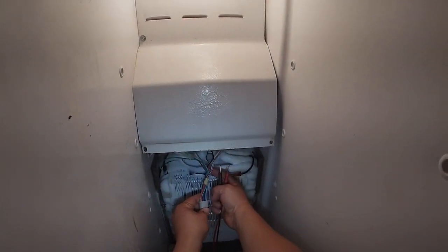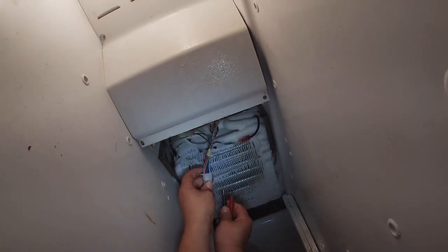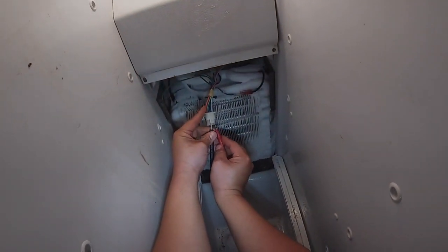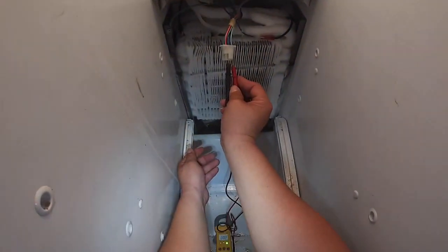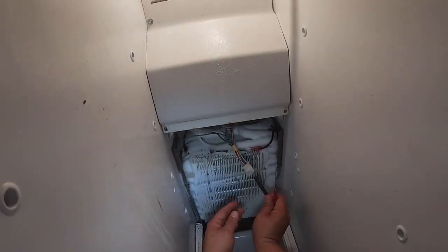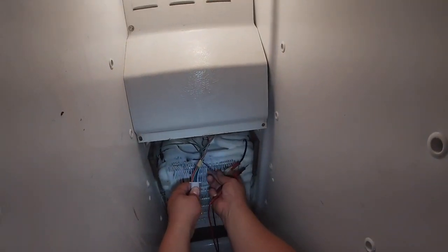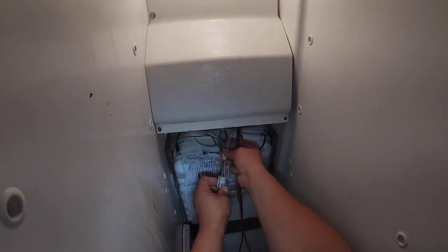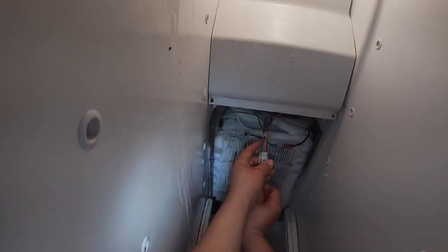In this case, what we're gonna do is just follow the wires from the defrost thermostat and the defrost heater in the harness and check with our ohmmeter or check for continuity. I have a tester that checks continuity with tone, so I just have to be paying attention to the tone. And in this case, it is giving me continuity, so it's beeping every time I test the terminals that come from the defrost thermostat and